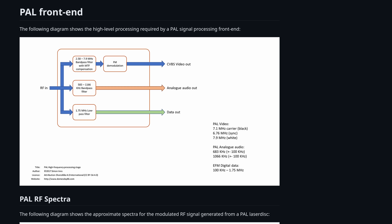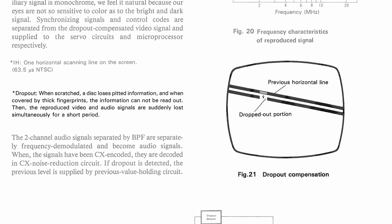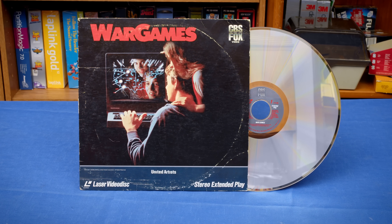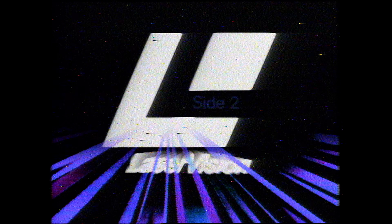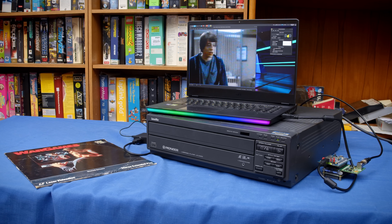This is also a good time to cover how damage impacts a signal. Laserdiscs are designed to handle missing a small amount of the signal at a time — these are called dropouts. The analog signal is interrupted and the video normally goes black during a dropout, but playback will typically not be stopped. Dropouts are unfortunately likely to become an increasingly large problem because Laserdiscs were not manufactured perfectly being so early for optical media. The terms laser rot or bit rot exist because of this and can be extremely bad — like for example this copy of War Games. The decay is causing many dropouts and the audio has a large amount of static hiss in it. This is one of the reasons why it's better to start now to preserve Laserdiscs — they may not still be functional in the future.